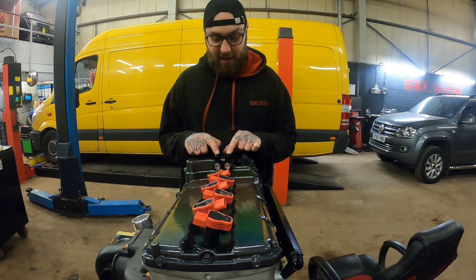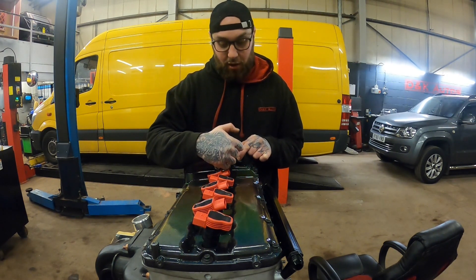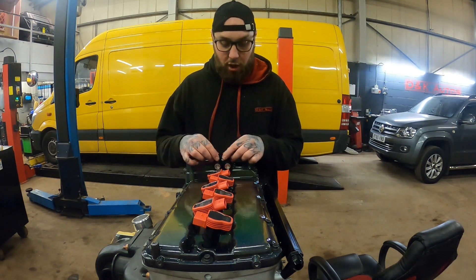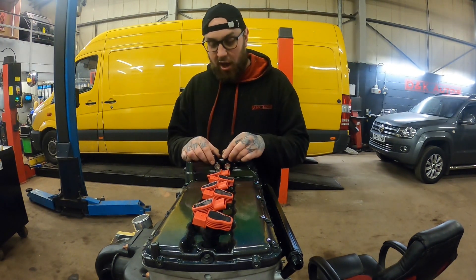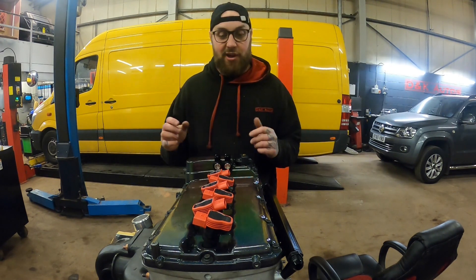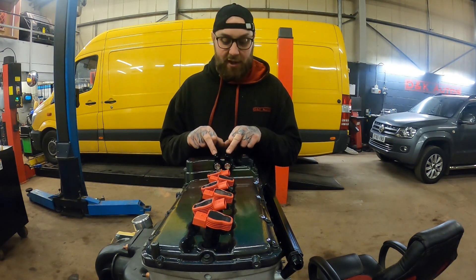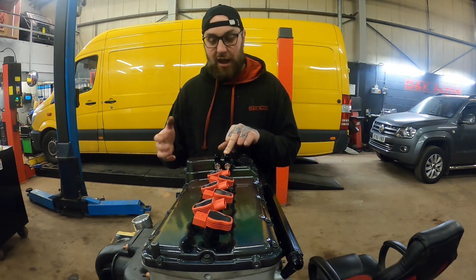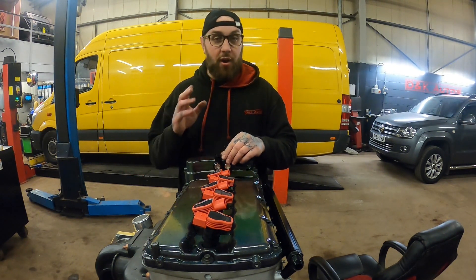Because of that issue I had to go back and get different fittings. I've got swivel banjos instead — these are completely tightened up, the silver center piece stays clamped, and the outer part can spin freely. So I don't know exactly which direction to point them yet, but luckily because they swivel, I can put the engine in, place the catch can where I want it, then just determine where these need to sit. These are two AN10 fittings, thread M18x1.5. I'm only going around 650-ish horsepower and it's a built engine so hopefully crank case pressure isn't that high.